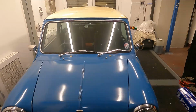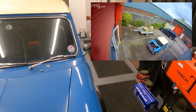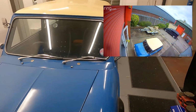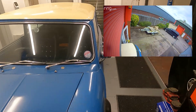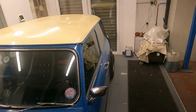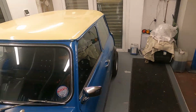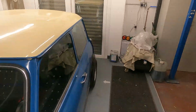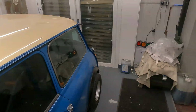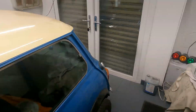Yeah, sorry I cut the video out, but I got it started. But I think I flooded it. I think I had the choke out too much, and then it wouldn't start. And I was thinking it wasn't getting any petrol, and it wouldn't start. And I pushed the choke in, tried to start it, and it started. So yeah, it's up and running, took it for a spin.